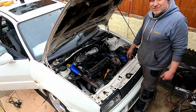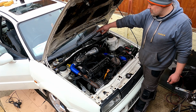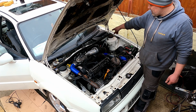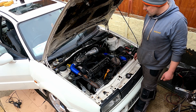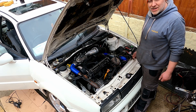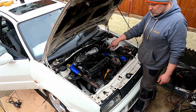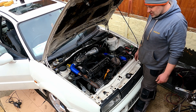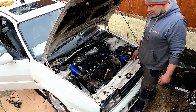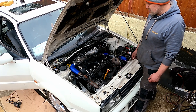Go and have a look at some of the other videos — there's air conditioning, a heater motor, and air conditioning pipes, so everything's all plumbed up. Once I actually get this MOT'd, hopefully I'll be able to get it nitrogen tested to make sure there's no leaks in the system. Using nitrogen is the right way to do it — there are no harmful gases leaking, and it's a lot cheaper than just getting it re-gassed and hoping for the best.